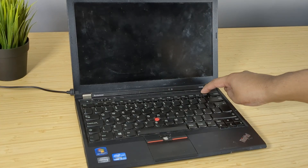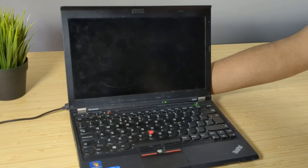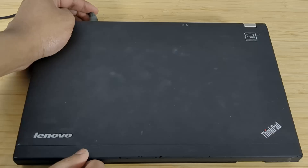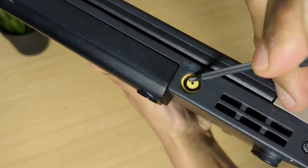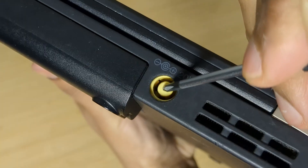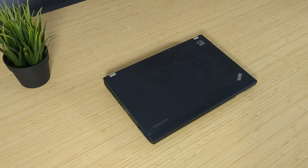After a few seconds there were clearly no signs of life, but as I went to properly insert the charger it suddenly booted up. Seems to be a simple charger port issue. The charger port can easily be replaced, or it's loose from its housing preventing a connection. Let's take this thing apart and see what's causing the issue — what could be happening is a loose connection to the DC port, and as expected it is quite loose in there. Let's disassemble this ThinkPad and investigate.